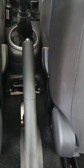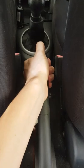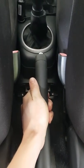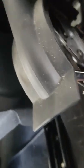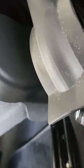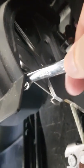What you want to do is pull up the handbrake to about three clicks. I've got blocks on the rear tires so that the car doesn't roll away. Pull it up one, two, three, and then start tightening it with a 10mm wrench until you've got a reasonably tight handbrake.